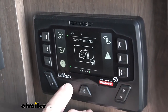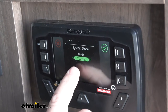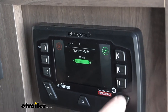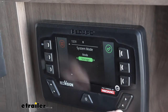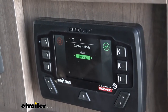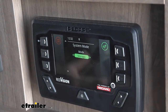You have your left and right arrows. You're going to come all the way over, use your up and down arrows, come to system settings, and it's going to tell you touring mode. When you're using it, you want to be in touring mode. This has the ability to go into storage mode. What storage mode does is the Manager 30 will maintain your battery while it's in storage — it's not going to allow it to drop down past a certain amount, maintaining that level so that when you come back to your camper, it's ready to go.